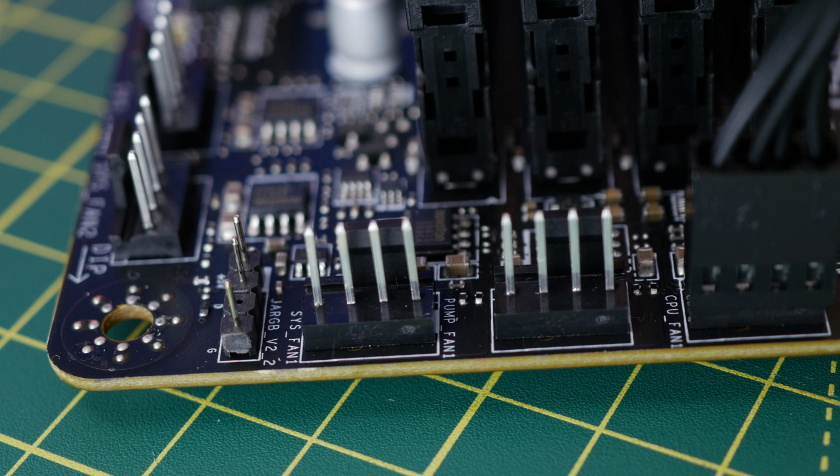However, what you will find quite quickly is that although you may have enough system fan headers, especially if you're using splitters, your 5-volt RGB headers may soon run out. I've just used 3 on this motherboard, now there's none left, so you can't connect a 4th fan. Here comes a solution in the form of this Thermalright RGB hub. So this is a powered RGB hub, which basically takes multiple RGB connections, not just fans, but anything that requires a 5-volt RGB header. So include, for example, lighting strips as a solution.